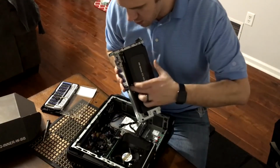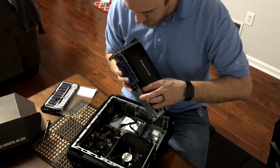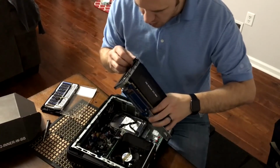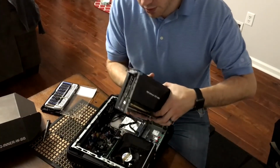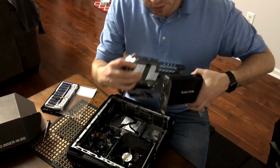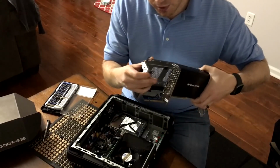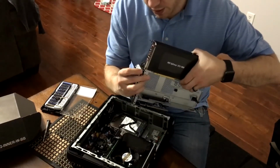You're going to make that riser card fit, slide right in with the slot on the card. Now, one thing to make sure, and I just ran into this now, this has an odd little, instead of putting a screw through it like a normal computer would, it has a little locking clip here. So you want to make sure it's fully open before you slide it in.